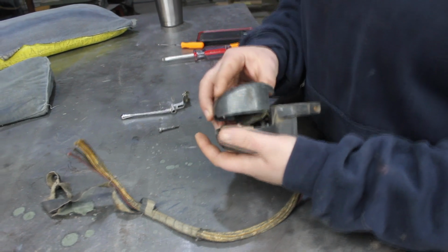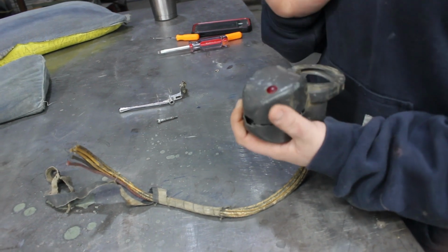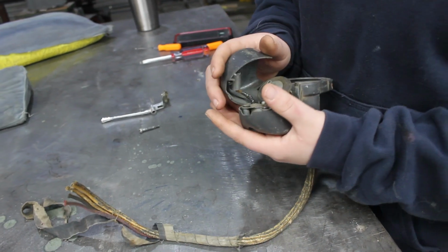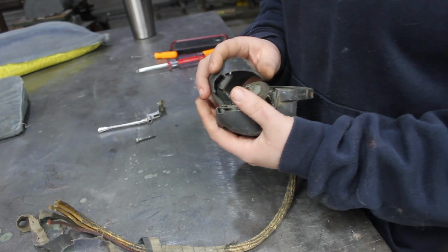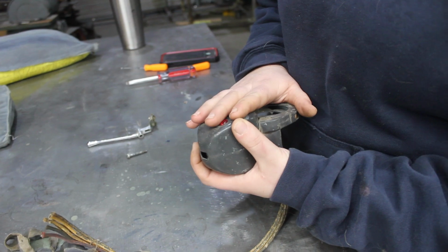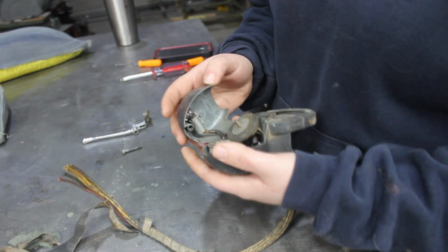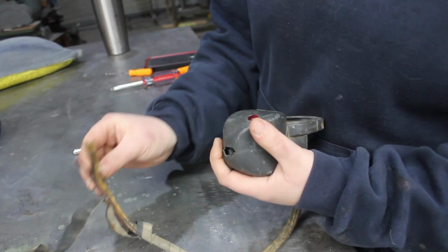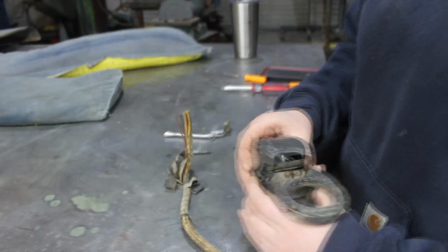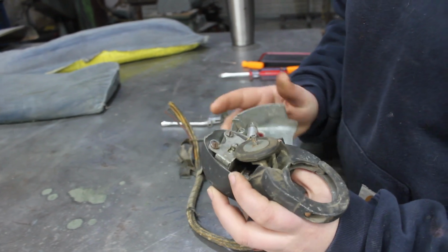Okay. So as a lot of you guys know, these cars don't typically come with certain modern safety features. And the Chevy did not come with a turn signal switch. It is an optional add-on that could have been done at the dealership, at the factory, or later in the car's life. So this car didn't actually have a turn signal switch. So I went online and I did some research when I was wiring in the harness. And I found that there was a 5-wire and a 7-wire switch that came aftermarket on these cars. So I went out and I found a Guide 6004 dealership option turn signal switch.